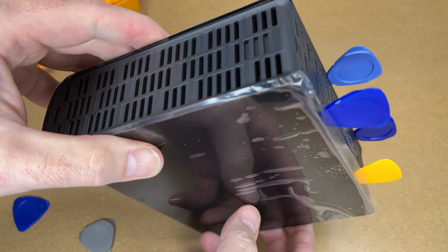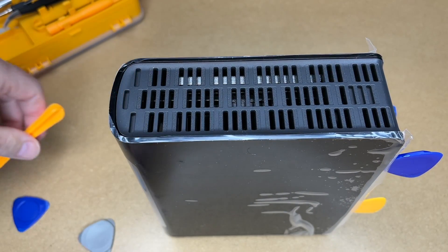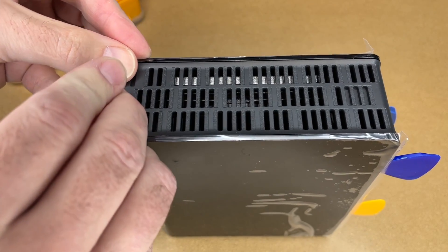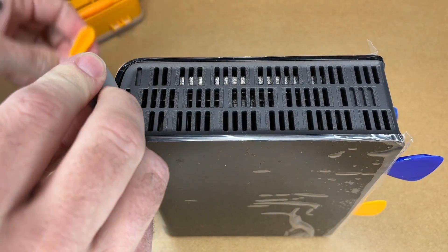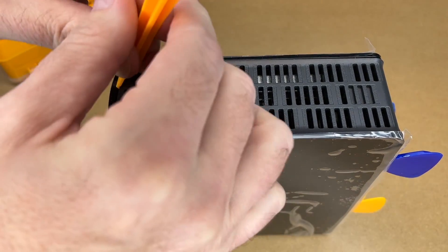I have picks in at those four locations. I'll tilt it up on its side. Now I'm going to pry in here — I have a spudger tool and I'll also use one of these picks to get it started. I've opened that up a little bit and can put the pry tool in there.